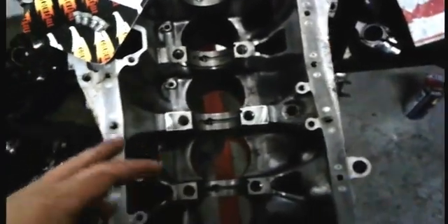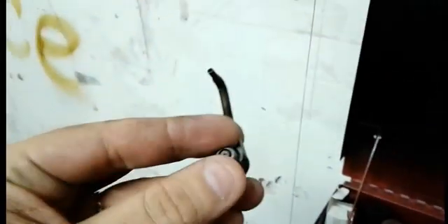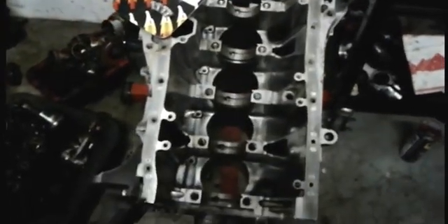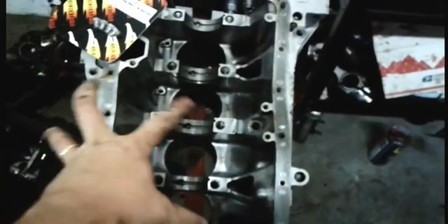It seems like GSR internals or the LS internals work fine in GSR. It's just that the oil squirters get in the way. So you have to either plug them off or bend them — bend the squirter. And the squirter is kind of thin on the metal. Oil squirter — you can bend that to make clearance. But it seems like this is going to be a turbo build. I don't want to risk higher RPM and all that good stuff with something bent. That's the last thing I need — that it breaks off and goes bouncing around making everything horrible.